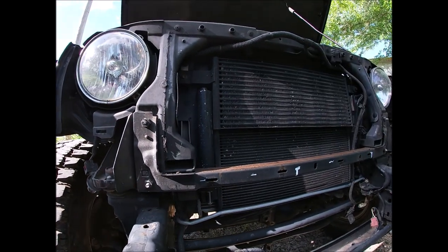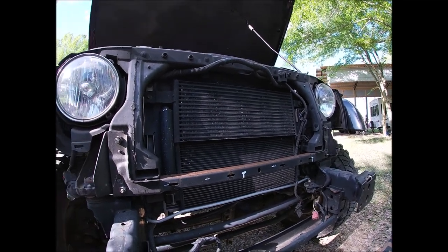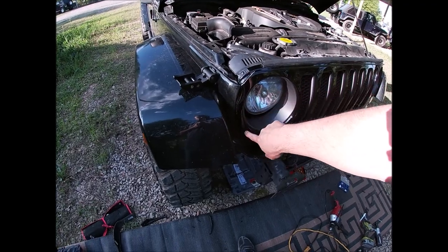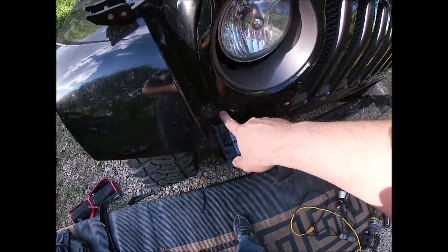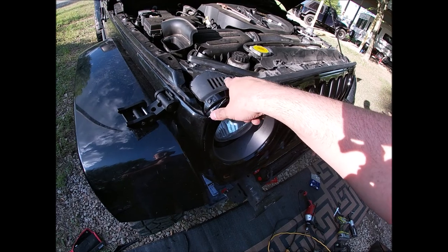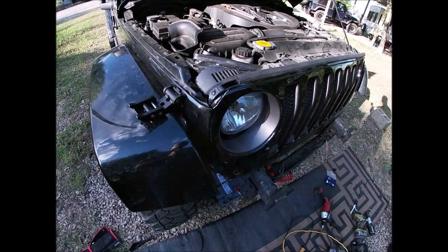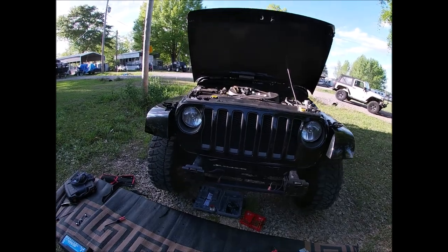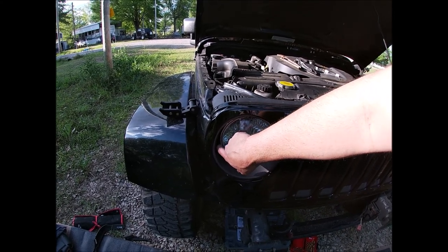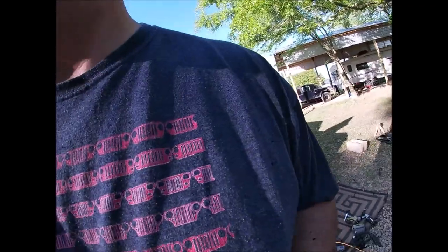So it is definitely not even close to a fit — you have to make it work. We're going to try to make it work; if it doesn't, we'll just put the other grill back. No harm, no foul. But we're going to make it work — I have confidence. So we're still trimming, slowly a little bit at a time. It doesn't really match up or fit down here. I'm still going to have to cut these corners off, which is going to put a little struggle right here. Because right now when you close the hood, the edge of the hood comes down over this since this grill sticks up a little bit further. The headlights are about half an inch off on each side. I think that can be solved by trimming out this ring and then painting this trim ring black — you'll never tell it's off from 50 feet.